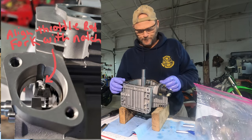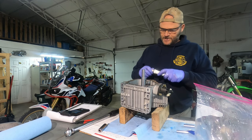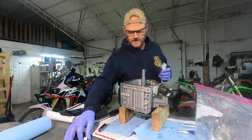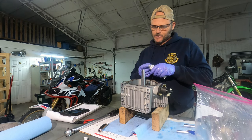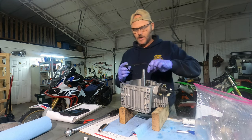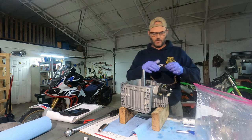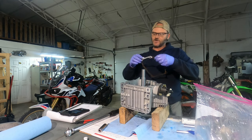I can see right now that it is in the correct location and it's moving. Time to reinstall the back cover. Since this gasket has been off, I'm going to use some 3-bond — it's 1184 gray. This stuff is really designed for a case-to-case, metal-to-metal situation. It is the stringiest, snotty stuff you've ever seen. Since this gasket has been used before, I'm going to go ahead and put a light layer on this. It's probably also one of the best sealing things I've ever seen.